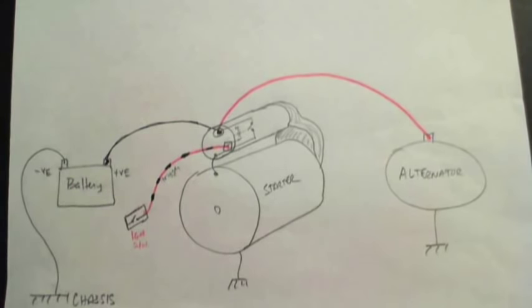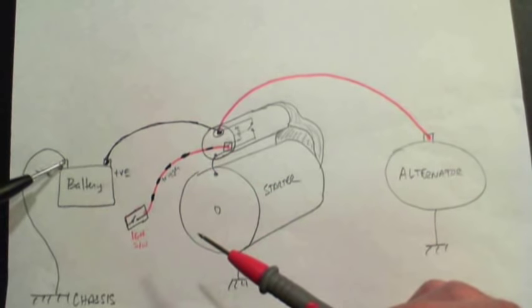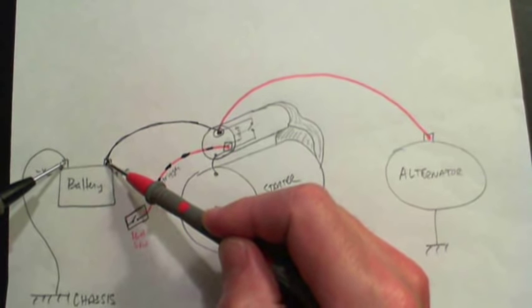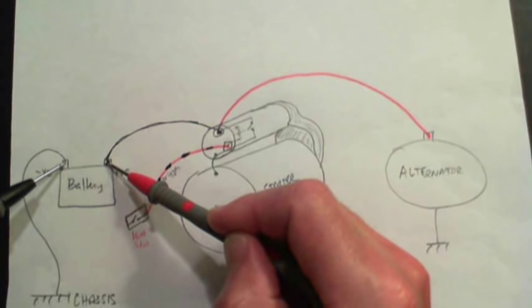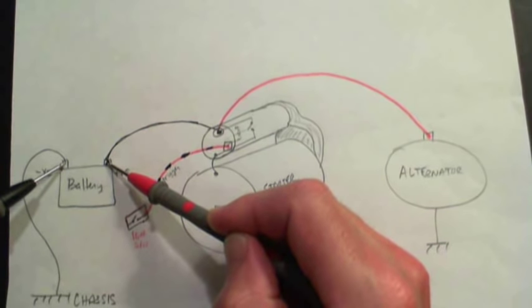To measure, take your voltmeter probes — put the black one on the battery negative cable and the positive probe on the battery positive cable. With the car off, you should be getting at least 12.4 volts. 12.4 volts means the battery is at about 75% capacity; 12.2 volts means 50% discharged. You should be getting 12.6 volts ideally. When someone turns the key, the battery voltage should drop to something like 11 volts or 10 volts while the starter is actually turning and you're hearing the engine crank — you wouldn't want to see it drop below 10.